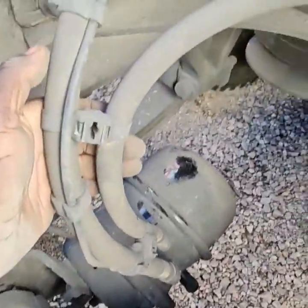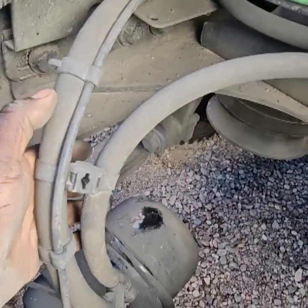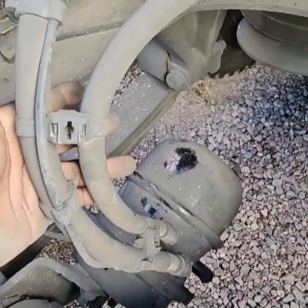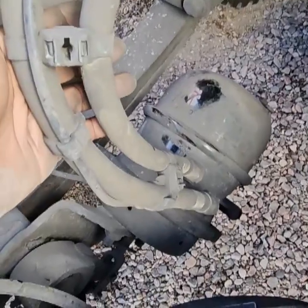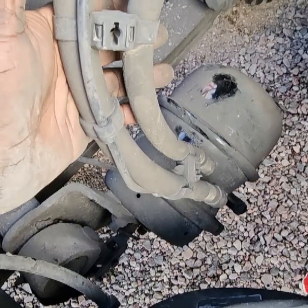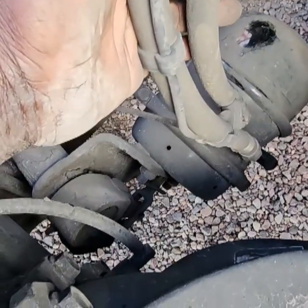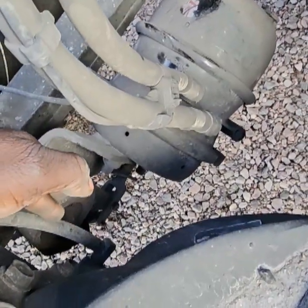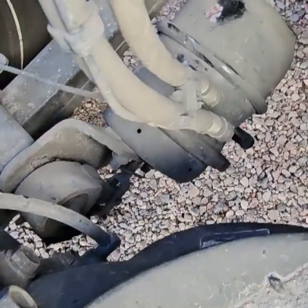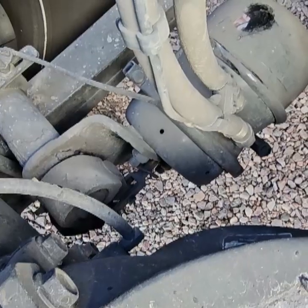This is parking and this is service, so just take note of it. If you have to mark them, just mark them. If you look closely, this one is skinnier than this one — just take note of that. You can mark them P and S, then put P and S on your new one and connect them appropriately. Make sure when you start taking things off you don't have any air applied to it, so it's in its resting position. Once I have it off, I'll show you how it looks.